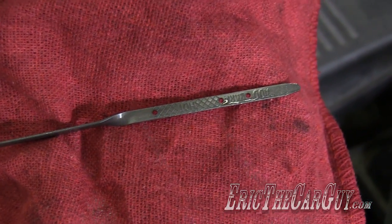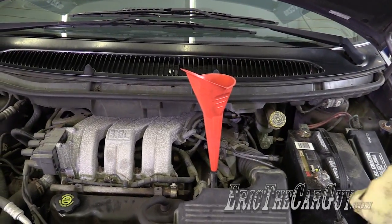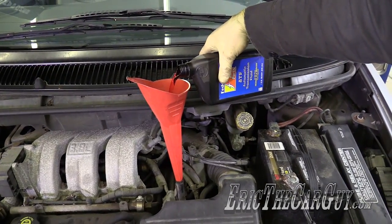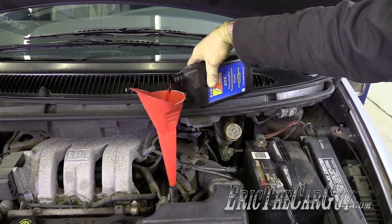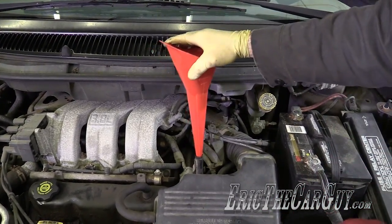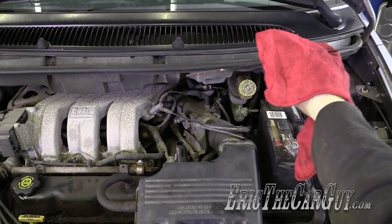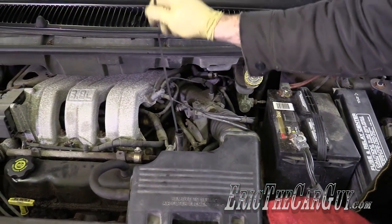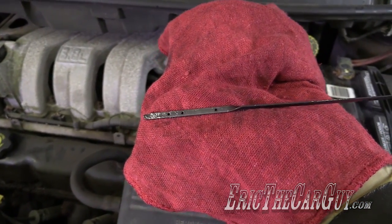Let's just try an experiment — let's put some fluid in it, see if it works again. I don't believe this takes any kind of special fluid, I'm just going to use regular ATF. Whenever you're adding fluid in a situation where you don't see anything on the stick, do it a half a quart at a time. Then you've got to let it settle, because what happens is the oil is going to get all up inside the dipstick, so it's difficult to get an accurate reading after you first dump it in. We're starting to register, but it's getting all over the stick — it's really tough to get a good reading. I'm going to have to let it settle.